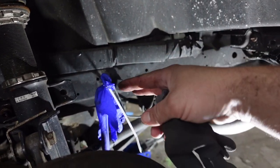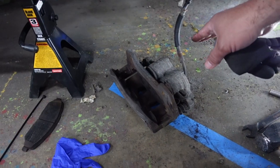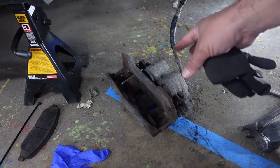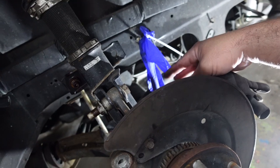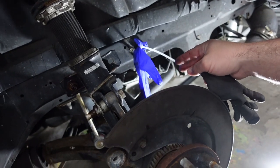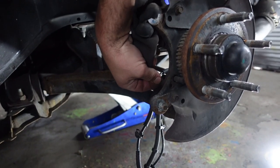I'm taking the brake line off of the front caliper — that should have been done before. I wanted to try to get away without bleeding the brakes, but I didn't want to put a lot of tension on the rubber line going to the caliper. Once you break this line you don't want brake fluid all over your garage floor and all over the metal. I used a glove — you can use towels or a baggie — to keep leakage to a minimum.